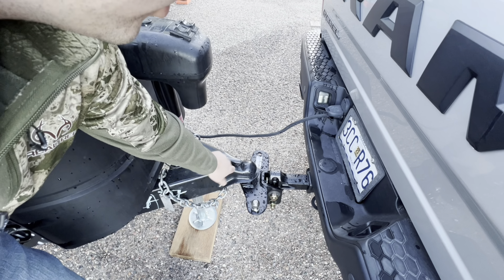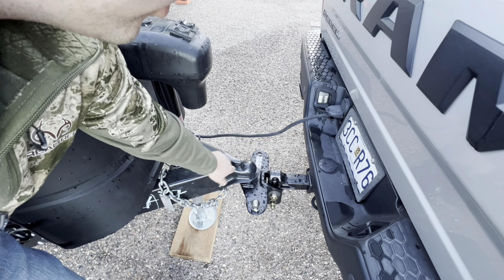You'll want to make sure your vehicle is level and your trailer is level. Then we're going to take our jack and raise the vehicle up probably three to four inches — maybe two in certain cases — but you'll have to figure that out for your setup. Essentially, instead of being flat, we're going to raise it up in the middle so there's more of an angle going up on both sides. The trailer is going to be up, the vehicle is going to be up, and then we'll install the bars. In theory, when we go back down to level, all that weight is going to rest on those bars and evenly distribute the weight across all axles on your combination vehicle.